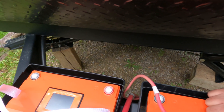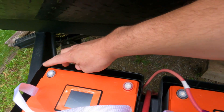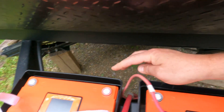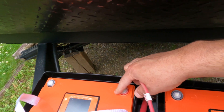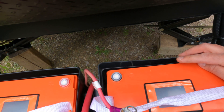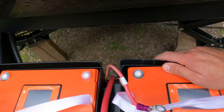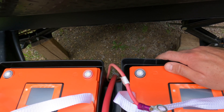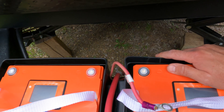This works out good. Now I just need to make cables to connect that negative to this negative and that positive to this positive. Then when I hook up the wires from the trailer, I'll connect to the positive on one battery and the negative on the other. They say that putting two batteries together that way — positive pulling off one battery and ground going to the other — helps keep all the cells balanced better.